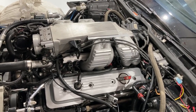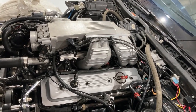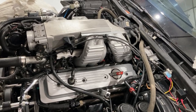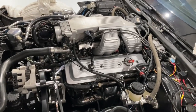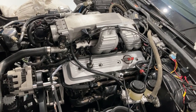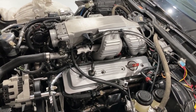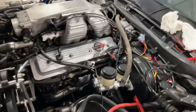You can vary that timing depending on your motor configuration. Some people run them down a little bit. I may have to run this one down because it's got almost 11 to 1 compression in the blower, but it'll probably work okay with the gas we're going to use. Some people run them up as high as 10 degrees on the base. The computer's going to do all sorts of stuff with it — once you plug that wire in, the timing may be way advanced at idle. It's all computer controlled, similar to vacuum advance.